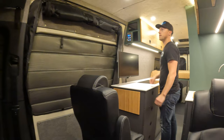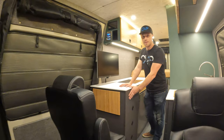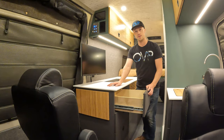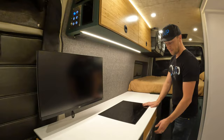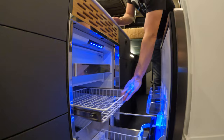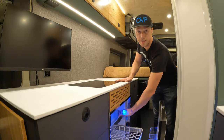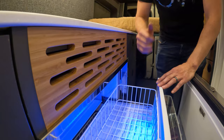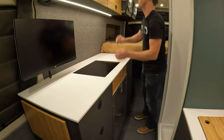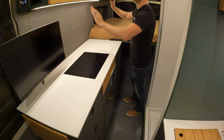We did add bug screens by Bug Wall, at the rear as well. We're using a hyper matte laminate — a really nice feel that's actually self-healing, so you can buff out a scratch and have it basically disappear. We've got the double induction cooktop and the big Isotherm 130 drawer-style fridge with wine in there for clients, a crisper drawer, and a freezer. A little trick: these freezers don't quite fit a pint of ice cream, so just snip out three of the little bars with wire cutters and the lid fits right in.